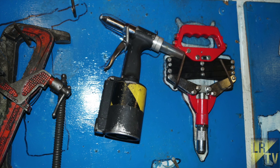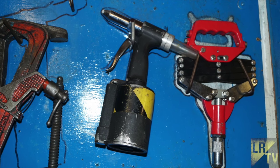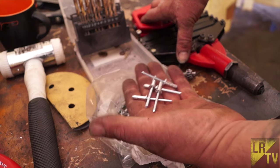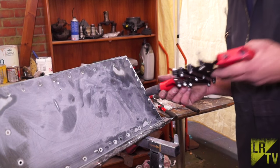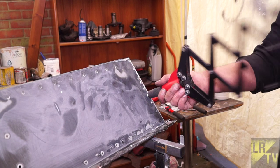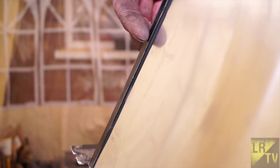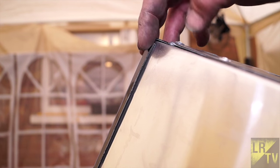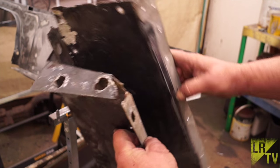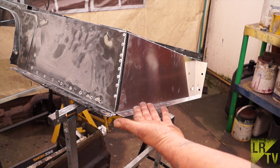I'll also show you the air-powered riveter — this is more for industrial use for doing thousands of rivets a day, very hard-wearing and labour-saving. Enough of the tool pornography — we'll get on and finish off fitting these aluminium rivets to the seatbox. Riveting itself on the seatbox is not going to look out of place since Land Rovers are mainly riveted anyway. This edge along here could do with knocking down very lightly with a soft-headed hammer or a piece of wood, trying not to corrugate or dent it. We've removed the parts that are rotten and turned the seatbox into something that is usable and very presentable.